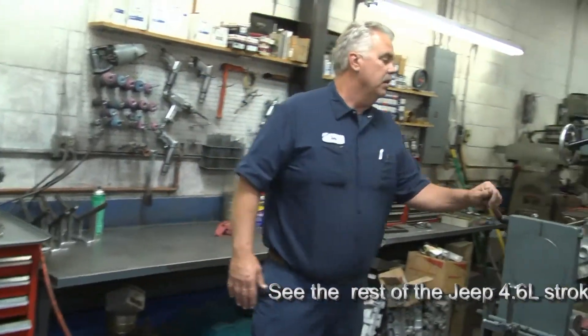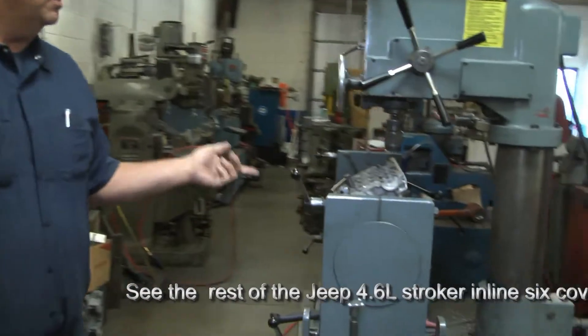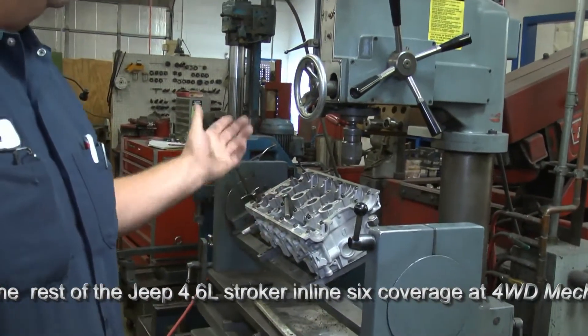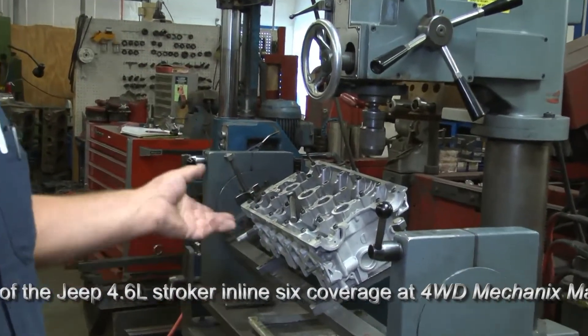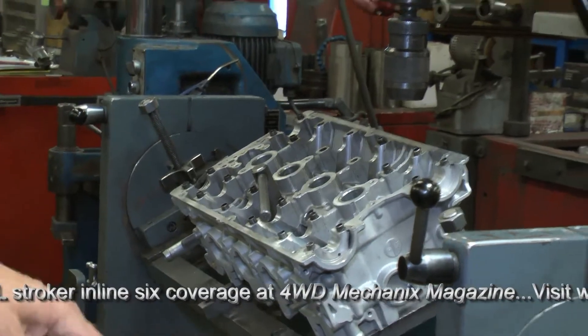This is your seat and guide machine. We use this for many things — put valve guides in, put valve seats in, machine valve seats. We actually put overhead cam cylinder heads together on this. You can see that my head guy Dan Brewer has an overhead cam head in right now, and he just got done taking all the springs off of it with this.